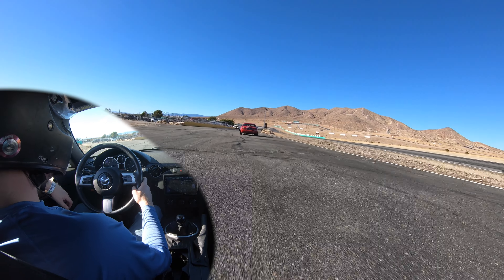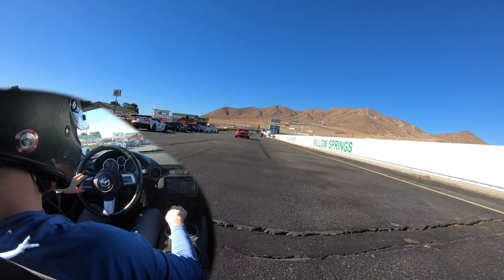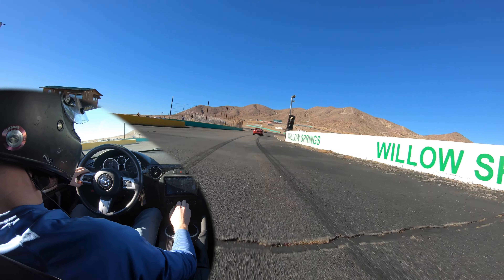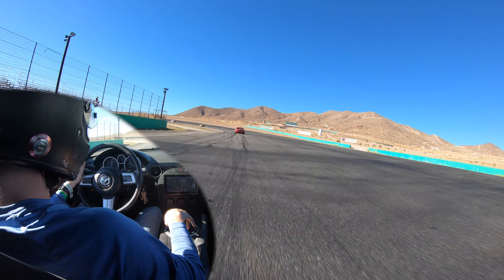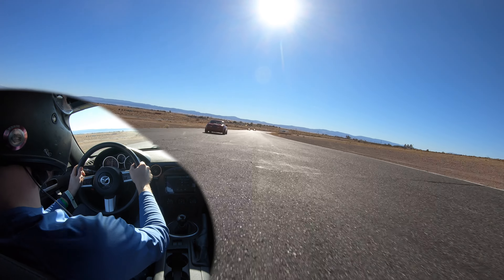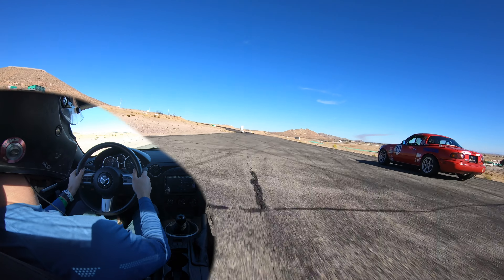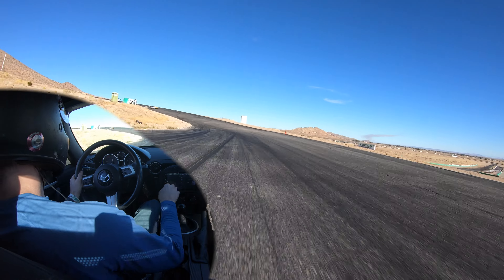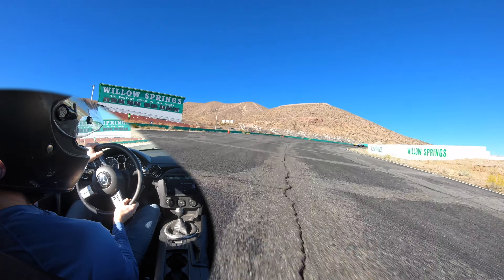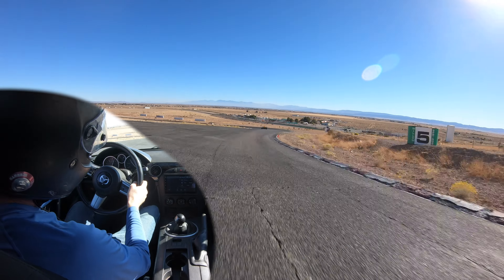One interesting thing about the diff is the front left wheel now rubs when I hit that corner. It's because the slip angle is a little bit different with the wheels locked up in the back — the car behaves completely differently. Looks like we have to get off the track. That's a major bummer. The Miata is doing well now, but the hot weather really does affect it. In the cold weather the car is much snappier and I'll see much higher speeds, so I've got to do something about the heat.